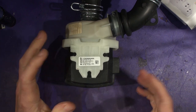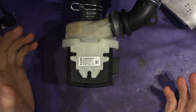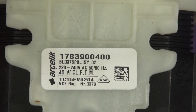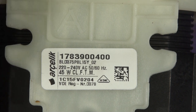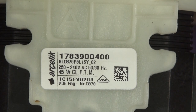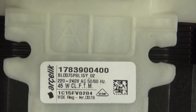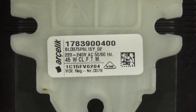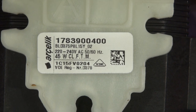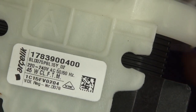The degree to which it trips depends - sometimes it'll trip straight away, other times it'll trip in a few minutes. When doing the debugging, you can unplug the pump and you still get some problems. We unplugged everything - all the solenoids, the controller - and even checked the wiring loom going up from underneath the dishwasher around the front access door to see if the wiring had shorted. It wasn't straightforward; it was a very intermittent fault.